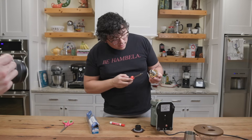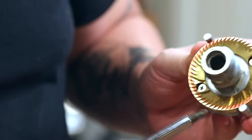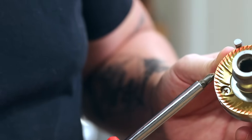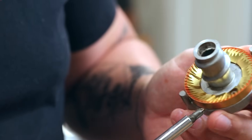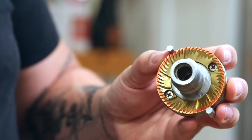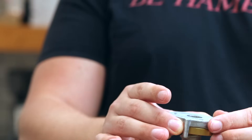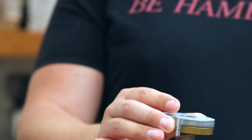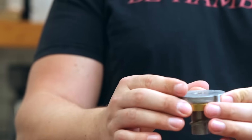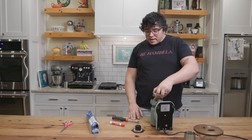So let's take a look at this up close. Can you see that dry erase? Right here it's wiped off — just this section. All of this still has its dry erase marker. So this is pretty horribly misaligned. That means just this part touched, which means this burr carrier has it tilted. As it's spinning, this is the only side that's hitting. So as it was spinning down, the burr carrier was just off — it's following that same path. This is the only part that's hitting.